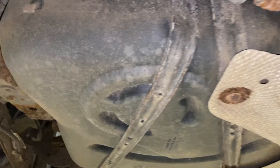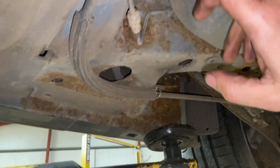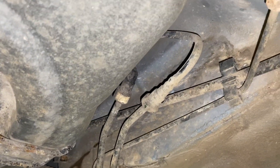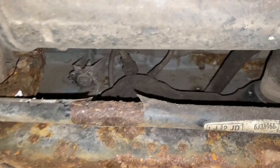Coming to the back, we've got the fuel tank here. A fuel filter would normally be located around this area as an inline filter, with two pipes coming off the tank. You can see those pipes just go straight into the main lines down the body — so there's no fuel filter on this one. Some models do have them located a bit further back, so just have a good look around the fuel tank and you'll know if yours has got one.